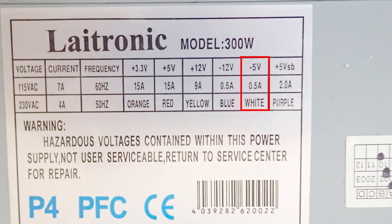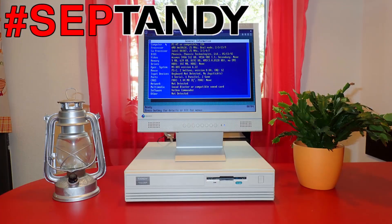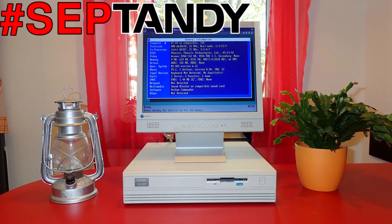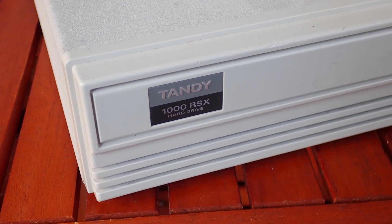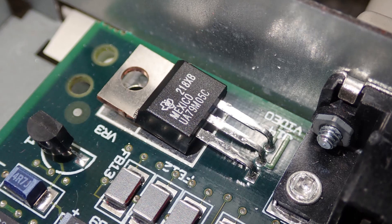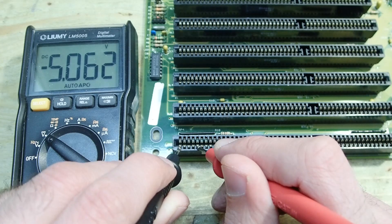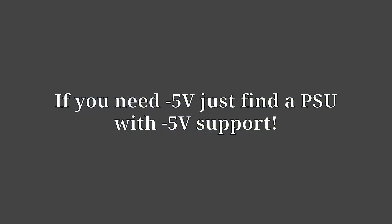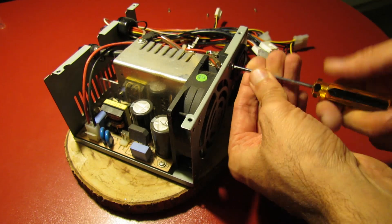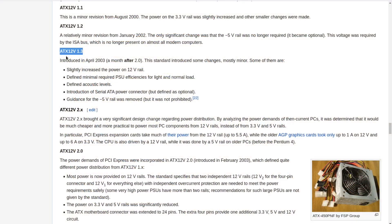How do you know if your system supports minus 5 volts? This one is also easy — look at the label of your PSU. If you see minus 5 volts there, you're good. If you watched my Tandy 2020 videos, you'll remember that the Tandy 1000 RSX provides minus 5 volts on the mainboard directly and not from the PSU. In such cases you can just check for voltage by measuring on the B5 pin of your ISA slot. If you need minus 5 volts, find a PSU with minus 5 volt support. The first problem is that old PSUs are getting older and unreliable — either maintain them properly and exchange parts, or go with a new ATX PSU.